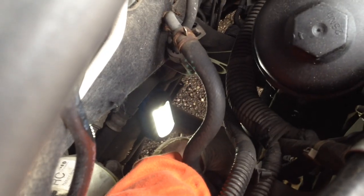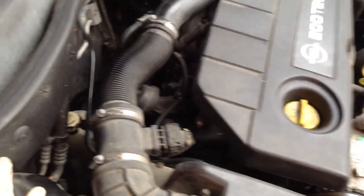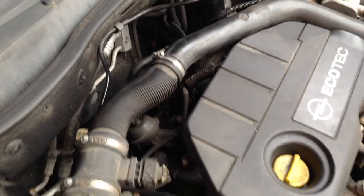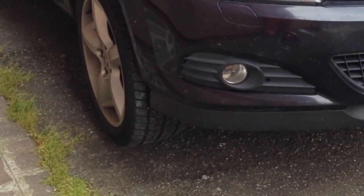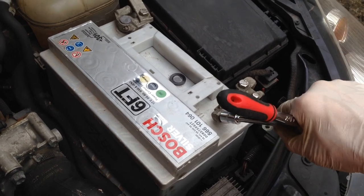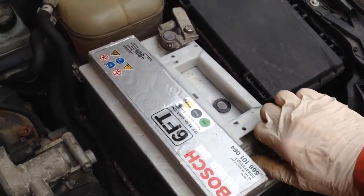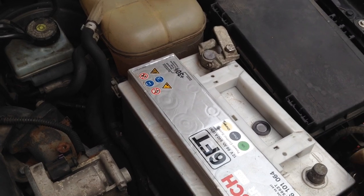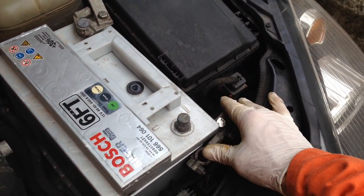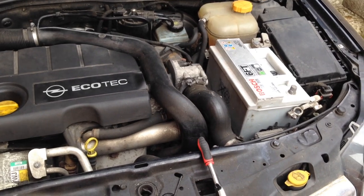I'm sure you can get this off without jacking up the car and doing it from the top, so if anybody has done this please leave a comment to help other people. We've jacked up the vehicle and it's on axle stands. We're now going to disconnect the negative terminal from the battery and put it somewhere safe where it's not going to touch the terminal again. This ensures the safety of both yourself and the vehicle's electronics.